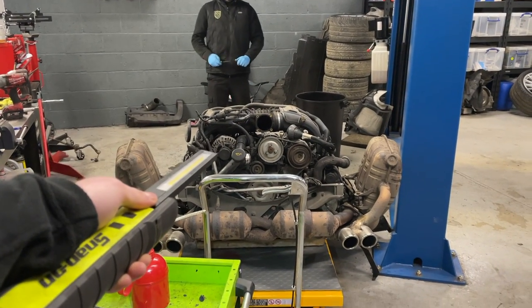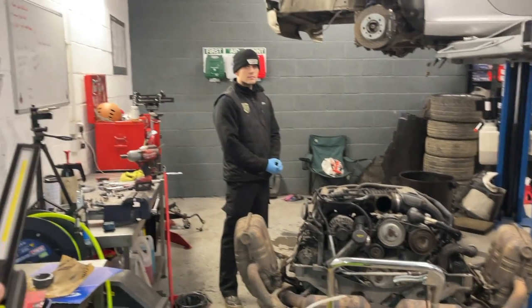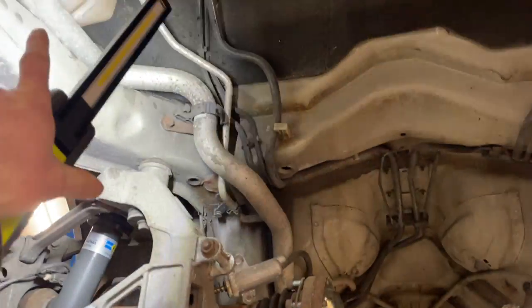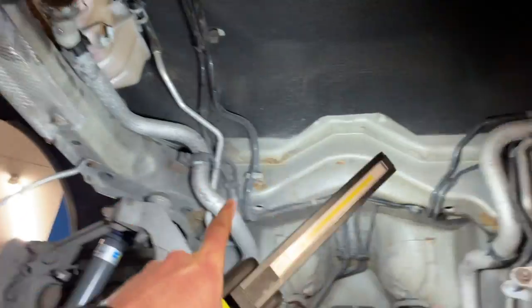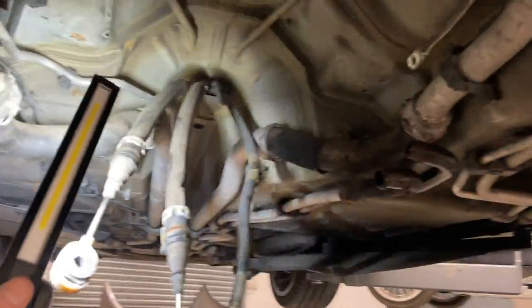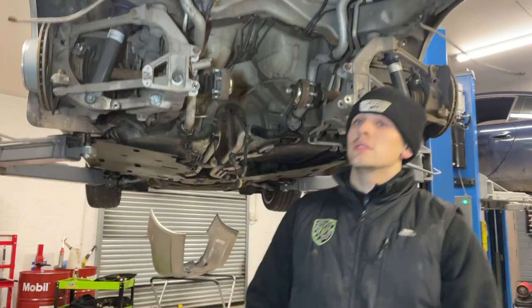The engine is obviously out as you can see now. Unfortunately my memory card ran out, I didn't get the timelapse, but we'll get that when it goes back in. Anyway, we'll show these two pipes again because they can be seen better now. Here is pipe number one, which is the return pipe going from the expansion tank. And here is pipe number two, which is the feed pipe. There's the corroded connection - we're going to replace the two rubber ones as well, this one and this short one here, then the centre ones which are okay as you can see.